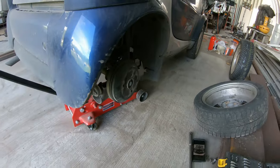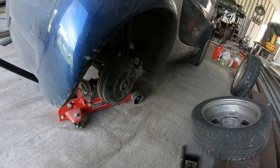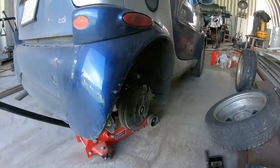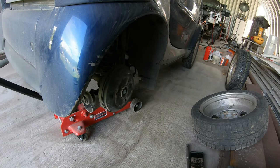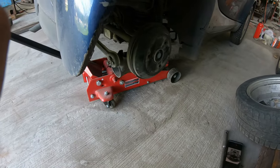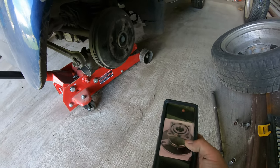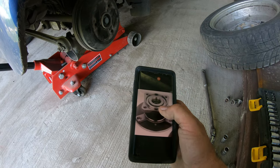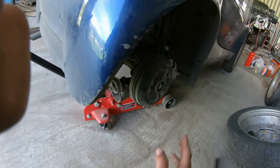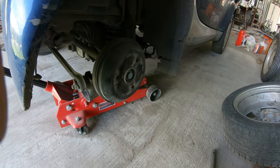I can't tell you to do that because this is the hub assembly for the wheel — it's not how it was designed to be adjusted. If you want to do that, it's 100% your decision. It's not very difficult, but don't do it just because I pointed it out — do it because you really want to adjust the rear camber and there's no other way to do it other than cutting and welding, or heating something red-hot and hitting it with a hammer. The bigger the washer, the more unsafe it's going to be, so use just little thin washers. If it's just a small issue, I'd suggest not even touching it — just buy new tires.